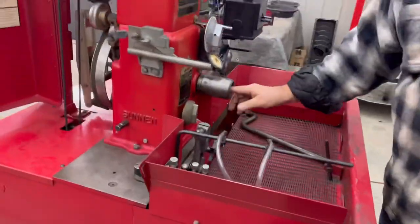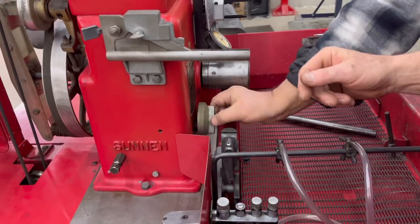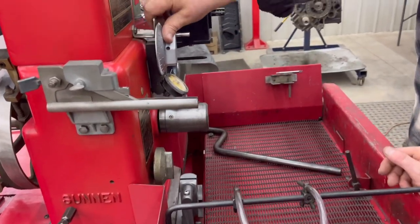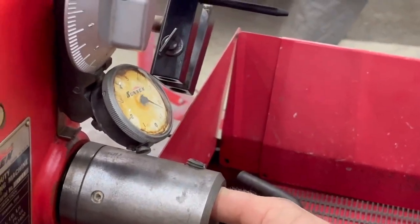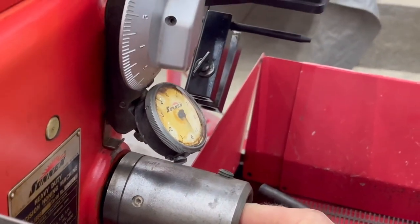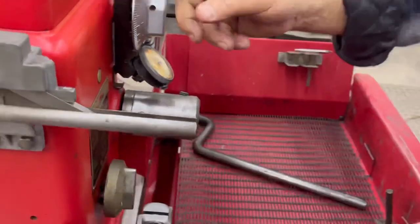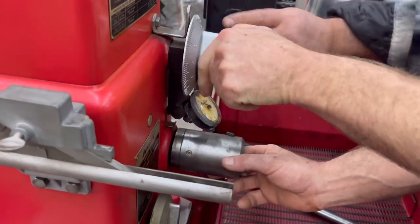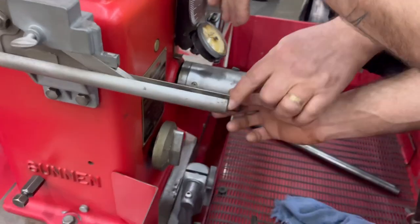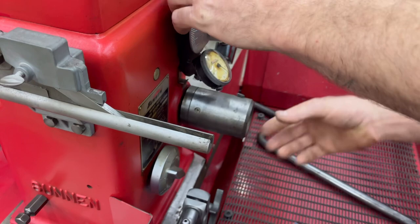Okay, this is your spring tension behind the feed rod. Left is loose, it's turned all the way to the left. Now watch what happens to that indicator. There's no spring tension at all. It's moving all that with it. The feed rod's kicking, all right? Now you push it and then add some tension to it. No tension on this knob, right, when you're pushing? Turn that up. No tension. Oh yeah, I saw it.